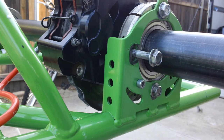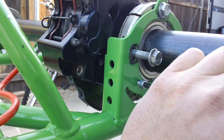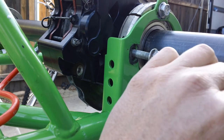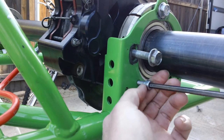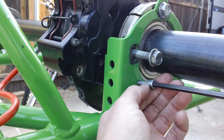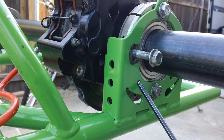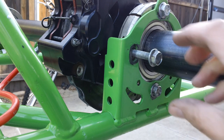So that's what this hole is for — to center the cassettes. Ever since I found that out, it's made the job of raising and lowering the axles much more efficient and accurate. I just use a standard five millimeter bolt. These cassettes inside are not threaded; this hole is not threaded and there are two of them, one on each side. Hope you found this video helpful — check out our page on YouTube, NorCal Carters, and our website norcalcarters.com. Thank you and have a great day!